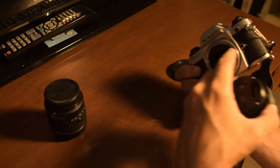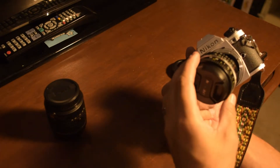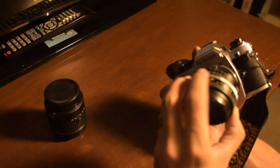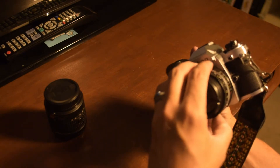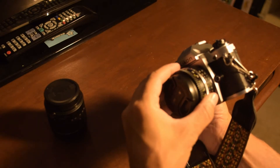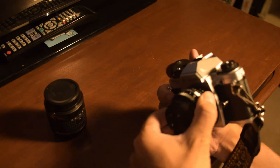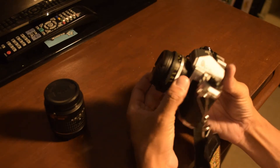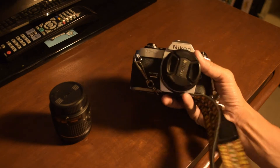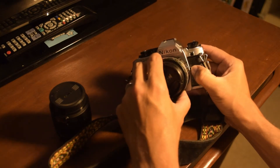If your lenses don't have dots to line up — in this case it does have a little black dot right here — sometimes the lens will have that spot to line up with. Usually where all the numbers are will sit at the top. Start a little back so you can go counterclockwise, carefully fitting it in. If it's made for it, you'll feel when it's right and it'll snap in. This is a manual lens, so I've got control of the aperture here; on newer lenses you may have different features.